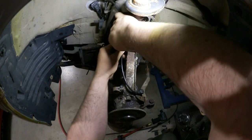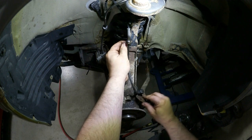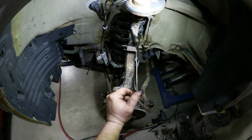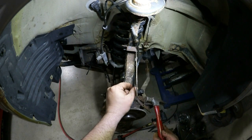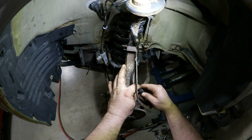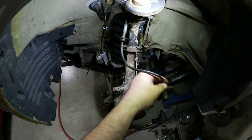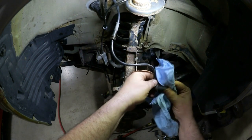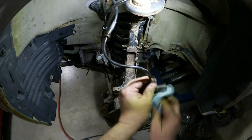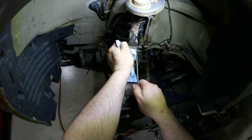Okay. Wheel speed wire. This bracket just slides off the steering knuckle. Wheel speed sensor with all kinds of crap all over it. The magnetic sensor, so all those little rust metal particles would just stick to it. So we'll hang that one over the control arm. Finish taking this bracket off.